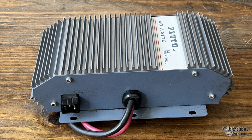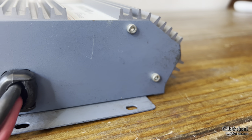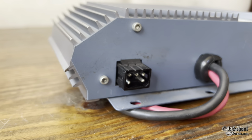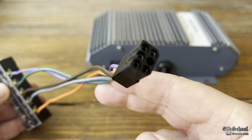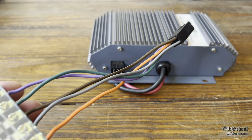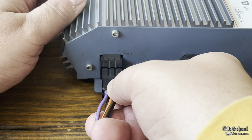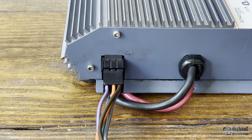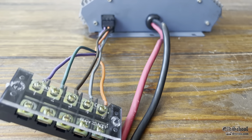On the opposite side, not a whole lot going on. We have power and ground wire coming out. We have a plug on the amp for the left and right speakers, as well as a remote turn-on wire. Here it is, the good old Molex plug — this one has five pins out of the six utilized. We are using a barrier strip there. We'll have a link in the video description to those, so you don't keep wasting the wires of your old school amps. It makes it really easy to hook up to your speakers — just screw-down terminals, just like these amps should have had.